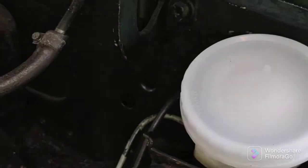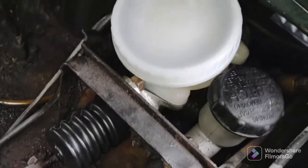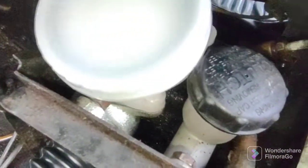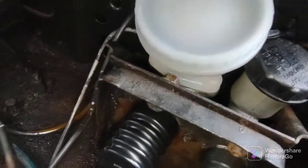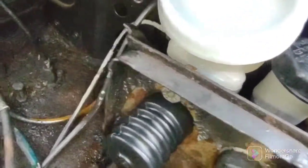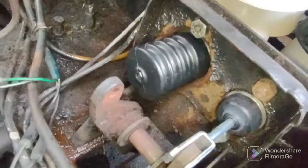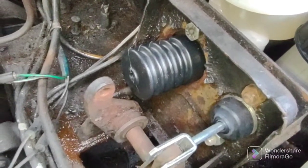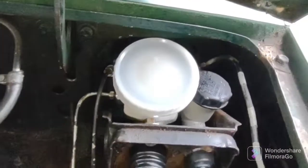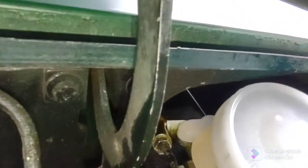Don't tighten anything until you get both bolts in. The bottom one - I might put the bolt through the back and put the nut on the front, that may be easier. It's in, it's a mess, fluids everywhere. Check for leaks of course. The bench bleeding was a mess - the plastic connectors leaked, so I don't have a perfect bleed on the master. I put the cover on it, brought it over to the car.